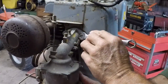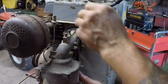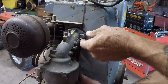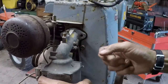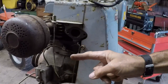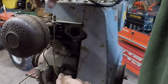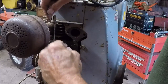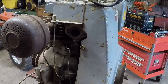We also have to remedy spark. If you guys remember, we did check this for spark. I'm not going to spend a great deal of time on this engine because I do need to get that 10 horse in running condition. Just pop that fuel line off right there and that's the only thing holding it. When you pull it, you can see it pulls on the governor and gives you more or less throttle. It's pretty nice.